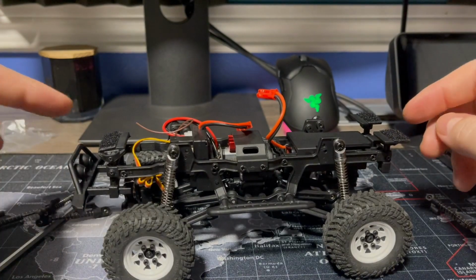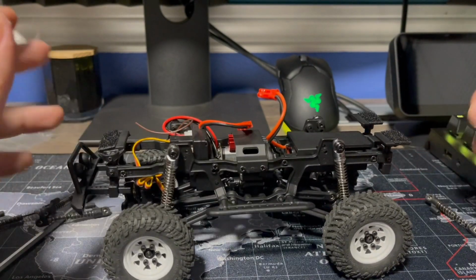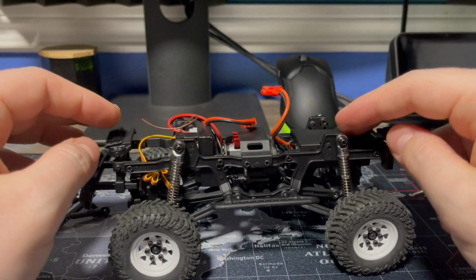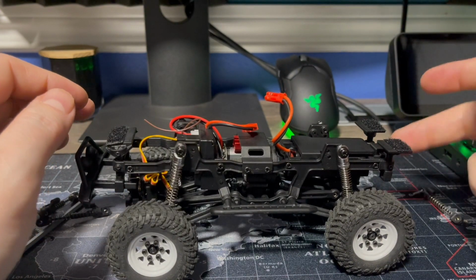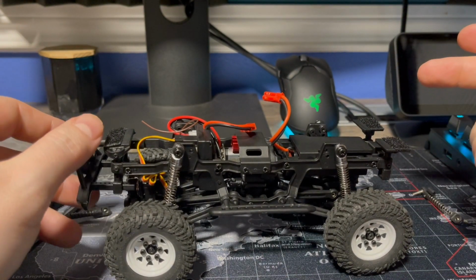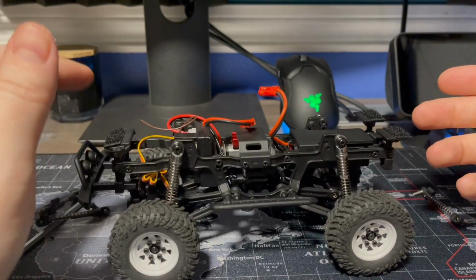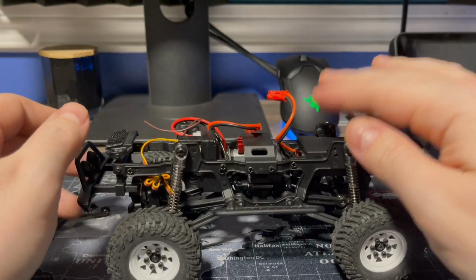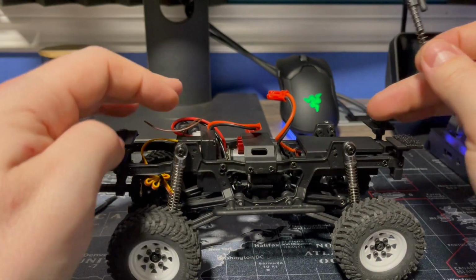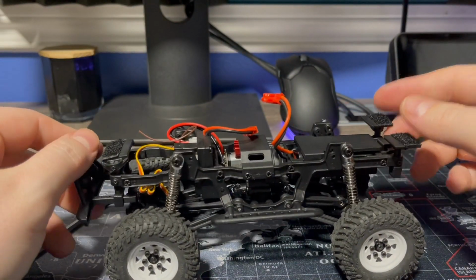Also, I'm sure you saw, the front has some bounce still, probably about the same as these, I would say. But I noticed when I assembled the shocks, two of them were a little stiffer. The rear ones, if you couldn't guess. So it comes back slowly. And these ones come right back. I put them on the rear. Because there were two that were really stiff, two that weren't, I wanted to make sure they were either both on the front or on the rear. So I decided to go with the rear.